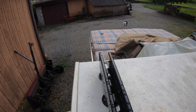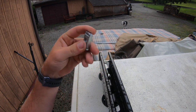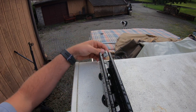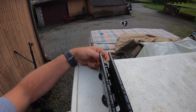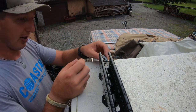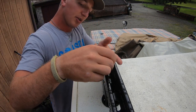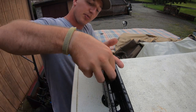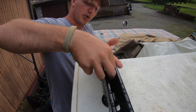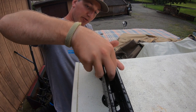You'll take the spring nut, part of it. You're going to go underneath this strut in between the two of them. You keep it sideways, it's the easiest way to do it. I'm going to try to get it in the middle hole. I honestly can't see it from here, too short. So I'm in the second hole back, so it's in the middle of the 6-inch piece of strut instead of being at one of the ends.